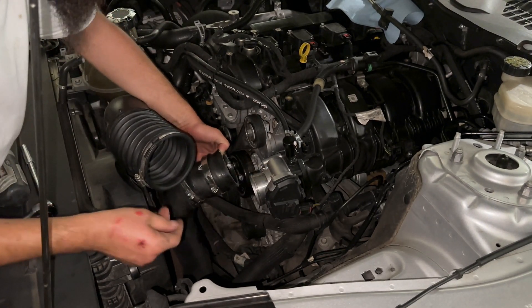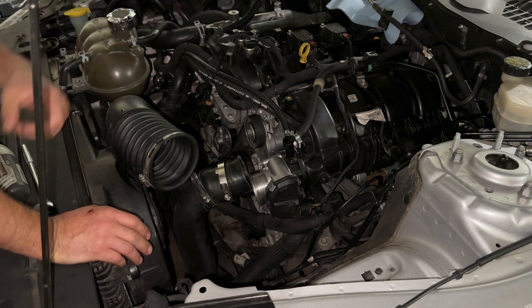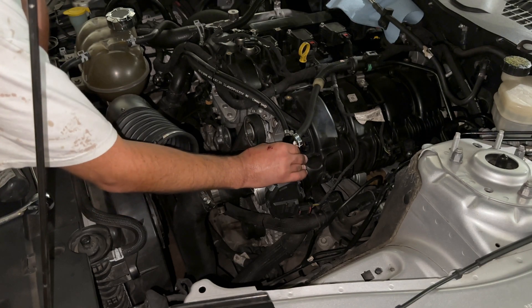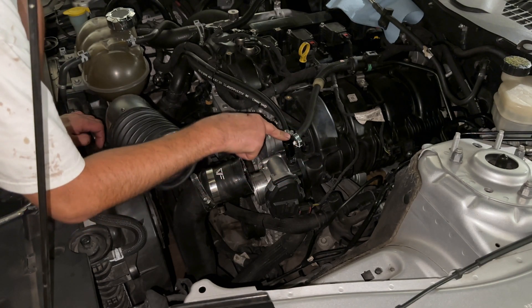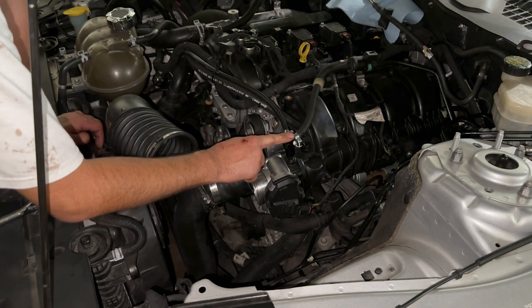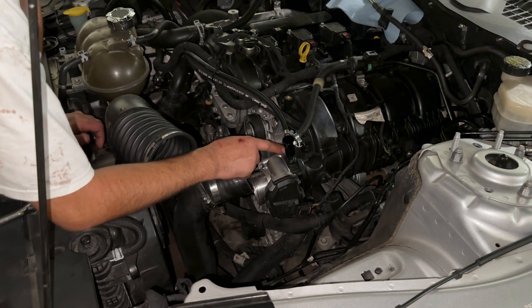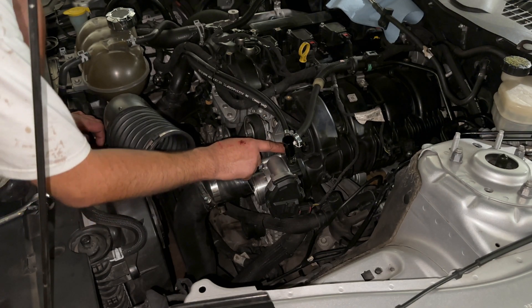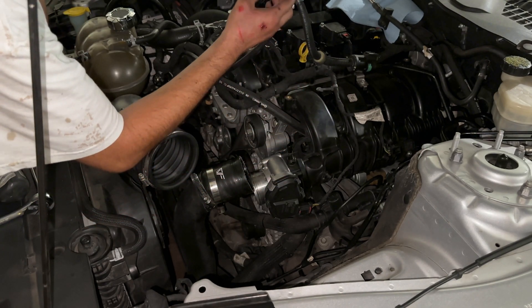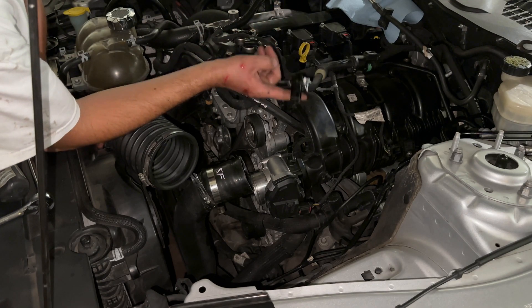All you need to do is take it off and pull it off just like that and get it out of the way because we're going to be taking off the intake runners. If you have an aftermarket blow-off valve, you're going to have this adapter — especially if you have the Tial port-shifted blow-off valve, it's going to come with this. There's going to be a pin that holds her down in place; take a little screwdriver, pull that pin out and push up on it. Make sure you don't damage the silicone rings in here — if you damage those, it's going to leak.